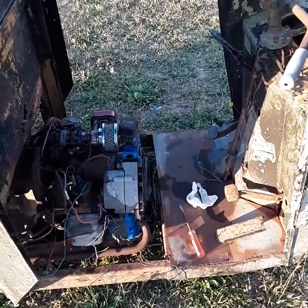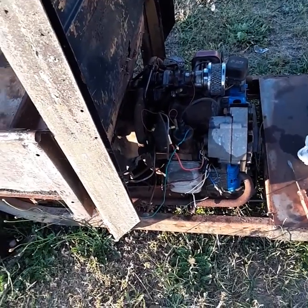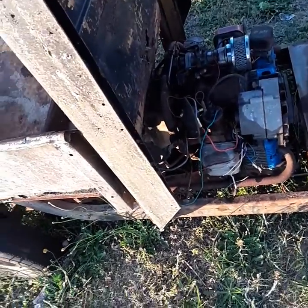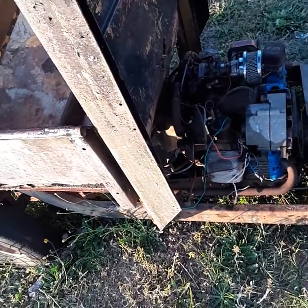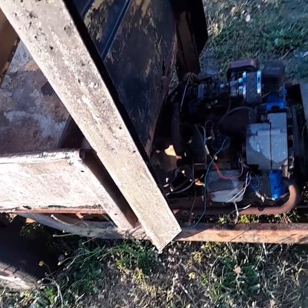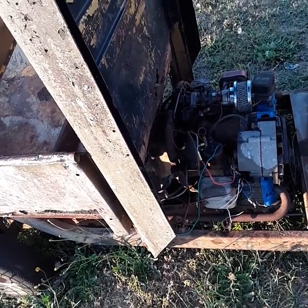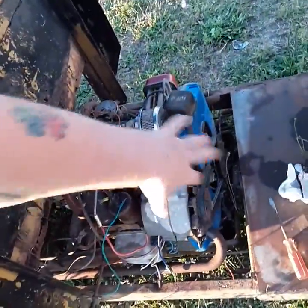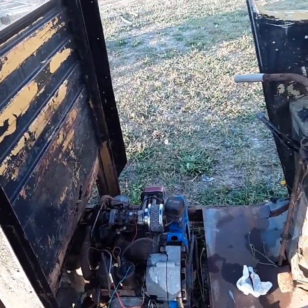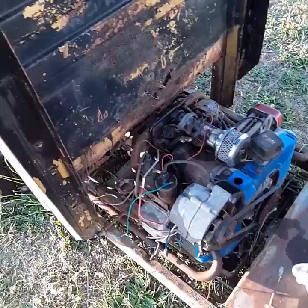Within the next few weeks I'm gonna rewire this thing because the wiring is a freaking mess on it right now. I don't think the alternator is charging — I don't even think the charging circuit is hooked up to where it would be charging the battery. But I have watched quite a few videos and these things are just loud — I'm not talking exhaust loud, I'm talking valve train and just in there. There's a lot of noise going on, which makes sense — it's air-cooled, and if you've ever heard a VW Bug running, there's a whole lot of noise going on in the back.